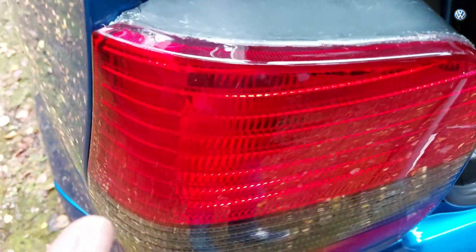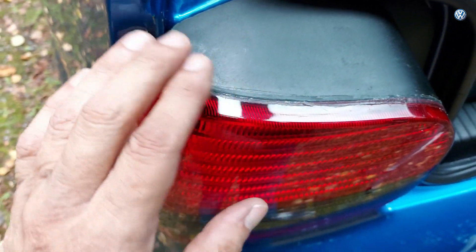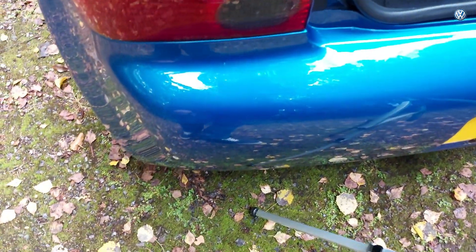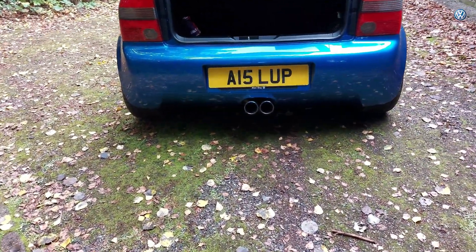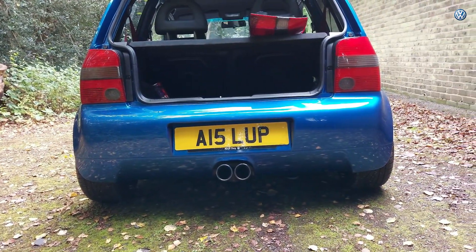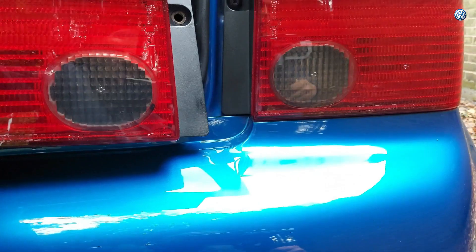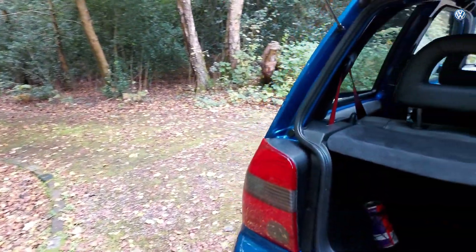I replaced it, and this time I put some headlight sealant on before fitting the light. I know it looks a little messy but I don't care — I just want the protection. The way to tell if this is happening: one reverse light gets darker than the other side. If you notice one reverse light is darker, check because you could have a leak problem with moss and debris building up inside.